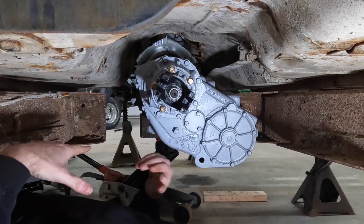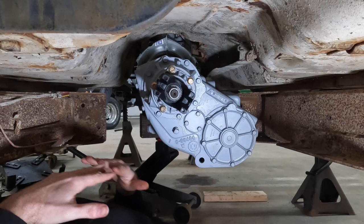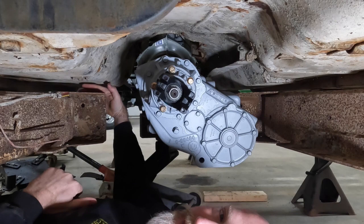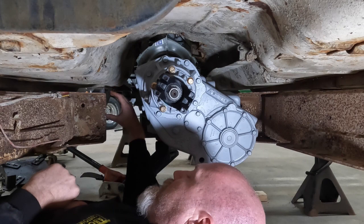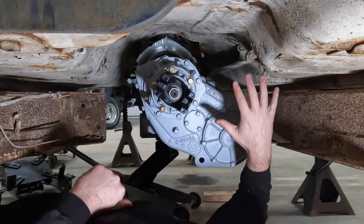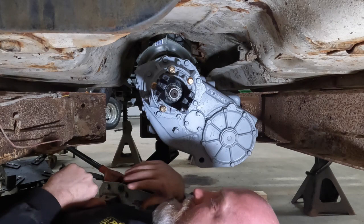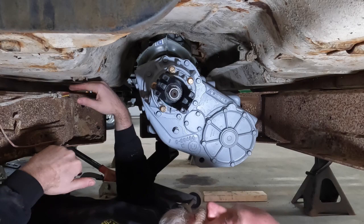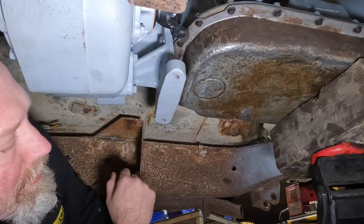And the other big issue on this Jeep is going to be exhaust. Exhaust is always kind of a pain, especially if you're going to run dual exhaust. And this one will be even more of a pain because it has some massive tubes coming back. So that's part of the reason why we're going to have to take this bracket over here once we get the cab off and probably cut off the top half of this bracket, so that we can work on routing our exhaust over here and pass the transfer case on this side, because once we get everything mounted, we're not going to have any space up in here to mount our exhaust through. We'll also end up having to put some sort of heat shielding either under the cab or inside the cab to make sure that we don't generate too much heat on the driver's floorboard here.